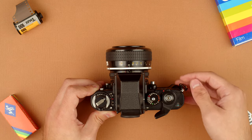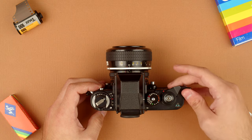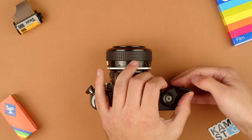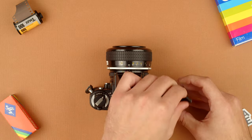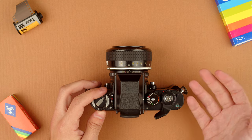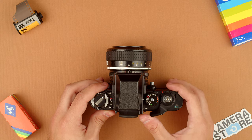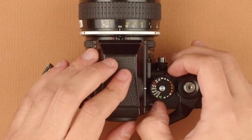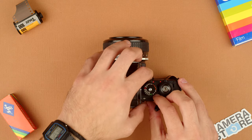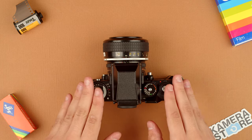We also have a multiple exposure lever here. When this is down, the camera will pull the film with every pull of this lever. When it's up, the camera is just activating the shutter instead of pulling the film. So if you want to do double exposures, it's very easy to do with this camera just with this lever. We have a frame counter here to tell us where we are in the roll. This lever here — if the red dot is out, that's the self-timer. The camera will activate a 10-second self-timer when that red dot is visible. So that just about covers the top of the camera.